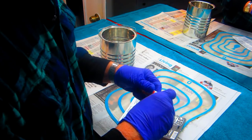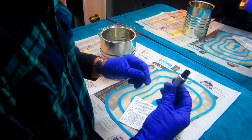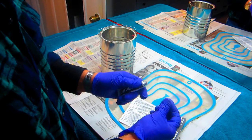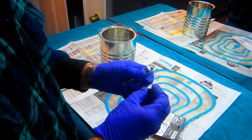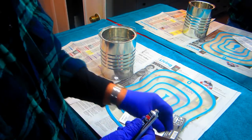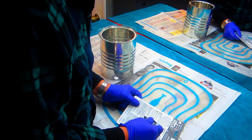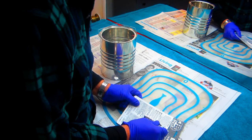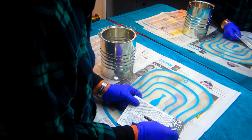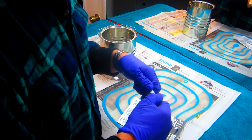Now, this material is really good. When people have problems with it, I've said that before, the problem is they haven't pre-cleaned the part. You never see this material break in the middle of the material. It pulls off the surface. And that's what happens. I wouldn't fix the frame of a motorcycle with this, but to seal an engine, small things that are not under terrible, terrible stress, this stuff really is a miracle.